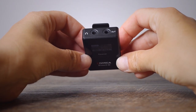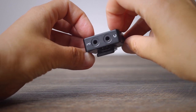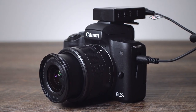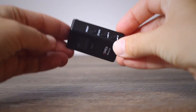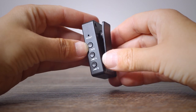It's time to look at the receiver. It has a 3.5mm jack output and a 3.5mm headphone jack. You can clip it to the hot shoe on the camera or attach it to a smartphone without a cover though. I found out that with my Moment case on the phone, it's just going to fall out — it's not wide enough to attach — but if you take the cover off, you can clip it on a smartphone. You would use a TRS to TRS cable for a camera like the Canon M50, and TRS to TRRS for a smartphone. For iPhone you also need an adapter. You can adjust the volume of each microphone and switch between mono and stereo — one microphone left and the other right, or both to both channels.